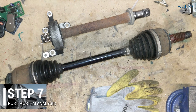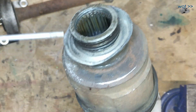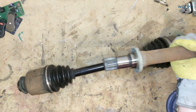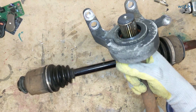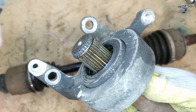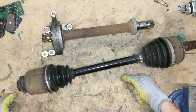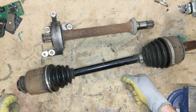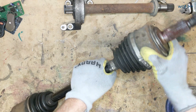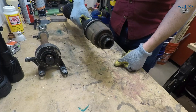Let's take a look at the equipment we pulled out of the Honda. This did end up going to the shop and they were able to get it out on the lift. Here's the CV axle — as expected, it is pretty banged up from vibrating. You can see some pitting and knockout on the spline teeth; it's been vibrating for a while and bashed everything down. On the other side we have the intermediate shaft — the transmission end looks fine, but the carrier bearing end shows the same pitting and knockout on the teeth, especially toward the end where it was vibrating back and forth. This piece definitely needs to be replaced. Most parts stores didn't have it; rather than order from the dealer at six or seven hundred dollars, I got a remanufactured one for about $200 off of eBay. Now looking at the CV axle — on one end it still sounds like it's doing everything it's supposed to, but on the other end there's a definite clatter — that was definitely going out.